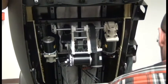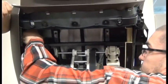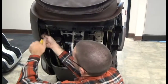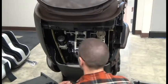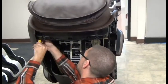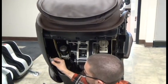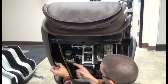Once the wheels are below the yellow part, it's good. At this point it's very important to put these tracks back on — if you don't, you'll end up with the mechanism falling out inside the backrest when testing. This is an important step you should not skip; just standard Phillips head screws. We also removed these side clamps that were mounted right here, held in place by Phillips head screws — we removed these for ease of getting the massage mechanism out, so remove these before you do the massage mechanism.